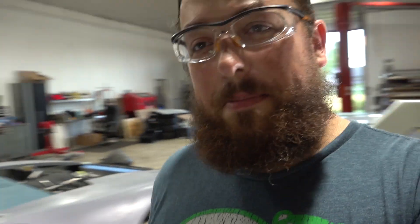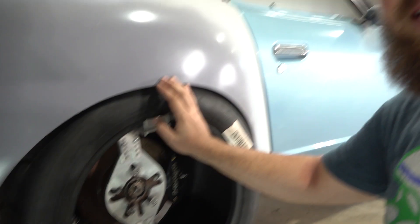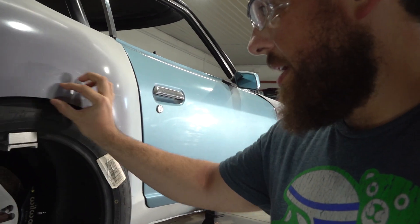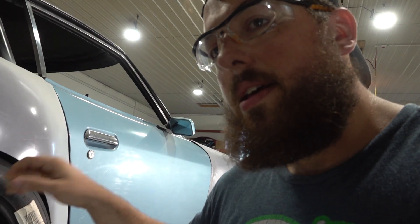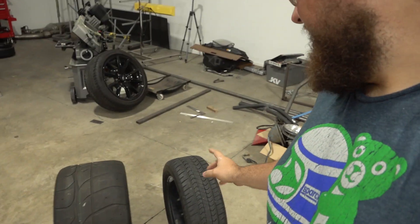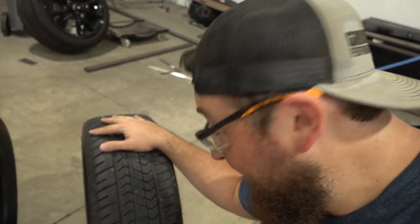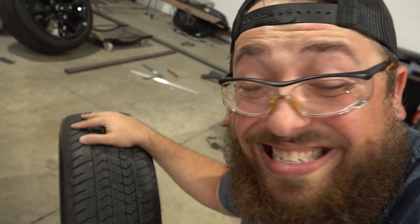After an uncomfortable amount of back and forth, I feel like we've settled on a pretty ridiculously cool wheel fitment for the car. For the rear, keep in mind we're still going to have to take about two inches off the arch. What I did here is overemphasize the camber so that it would tuck, then jacked it up to ride height to give me an idea of how far in and out the wheel's actually going to sit. And I have to quickly point this out — when you get this deep in a project, it's really easy to forget where you started. This is the original wheel and tire off the car, and this is what we're moving to. It's significant. This tire was made in 1979 and I drove on these for months.